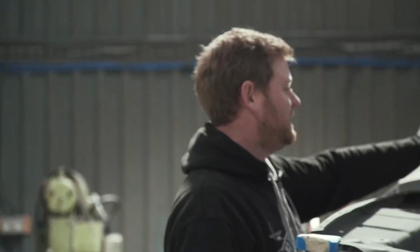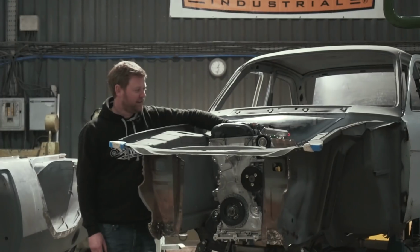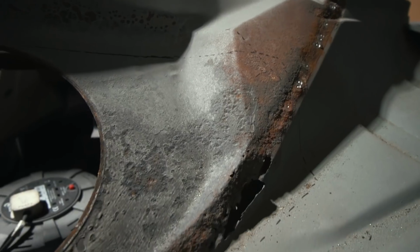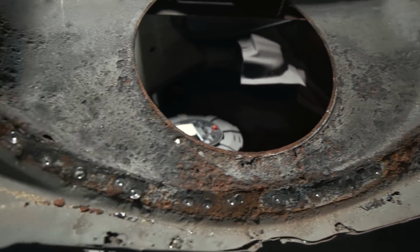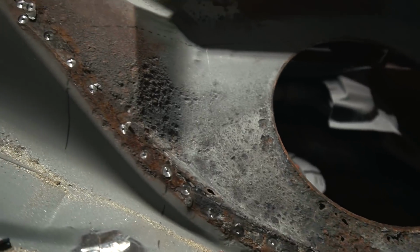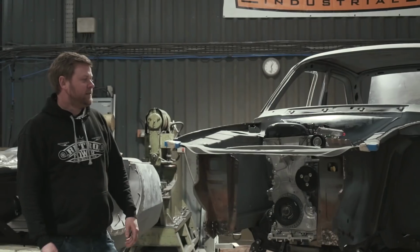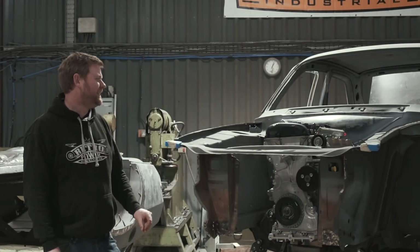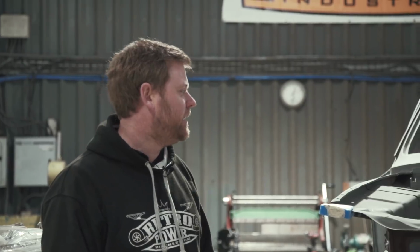So we started with the heater intake area. We talked before about the fact that this is quite a rust trap, and when we took that outer skin off, it was really badly rusty inside there. And you could tell that in the factory there was just no coating, no paint inside that area at all. And the water actually runs down inside there and out of the drain. So it literally looked like part of the Titanic in there. It was bad. So not only have we repaired that, we decided to redesign that area so that the same thing wouldn't happen again.